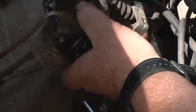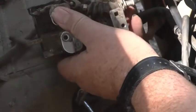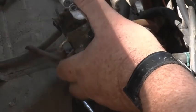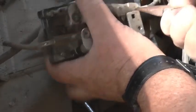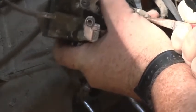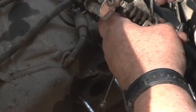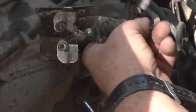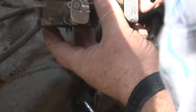Do the same thing over here with the throttle cable - pull that little pin out, push that one up, take that off of there. Okay this has got a little keeper in it - take a pull on it. The problem with this clip is it's kind of turned around there. See if I can get it from the top side up here. There we got it, see right there.